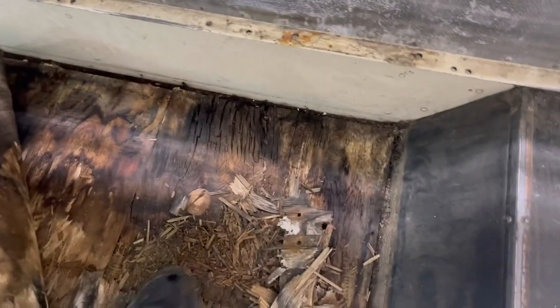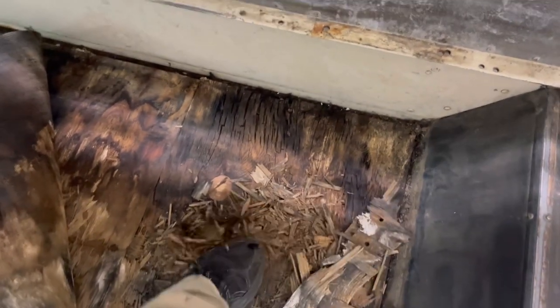When I stood on one spot it felt really uneven, so I pulled back the rubber flooring and the wooden subfloor is way worse than I thought. It's definitely been wet, probably from canoers dripping or whatever they brought back in the bus. It could have just been somebody leaving a window open — I have no idea. What I'm going to do is instead of putting new subfloor over the subfloor, I'm going to have to rip out all the original rubber flooring and take it back down to the metal.